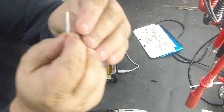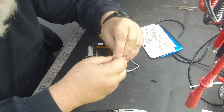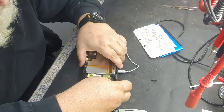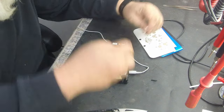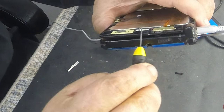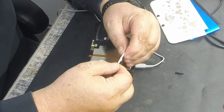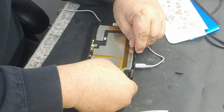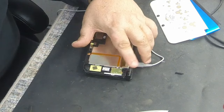I've actually got some spares from donor units — I have a white one here. It's not the right color but it doesn't matter since the only part you see is the gray part anyway. This is your new slider switch. If you look at it, there's a little notch on there. What you're going to do is take that notch and line it up with the slider on the board. The slider got pushed all the way up so I'll take my screwdriver and center it back. You can see that little tab sticking out — that's your 3D slider. Then you take that notch on the back of the new one and line it up — and now it'll slide in and out. That's it!